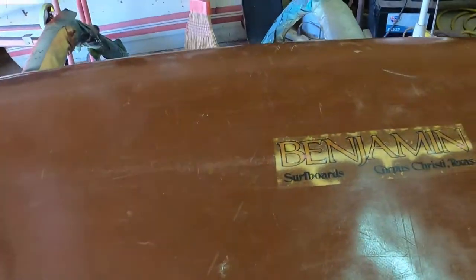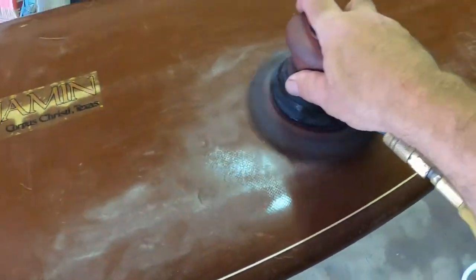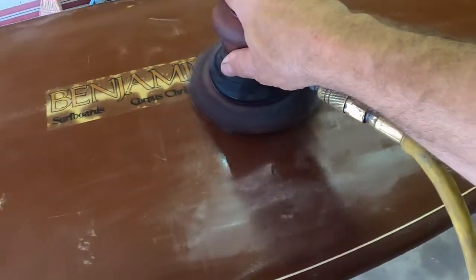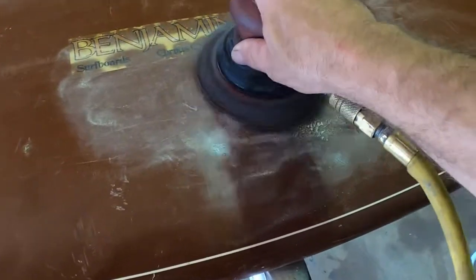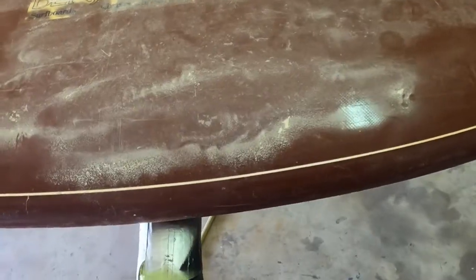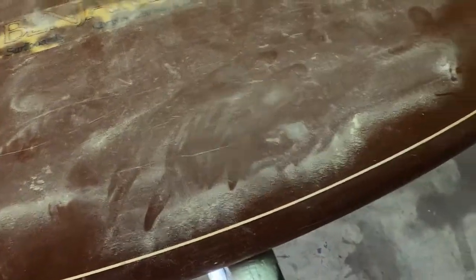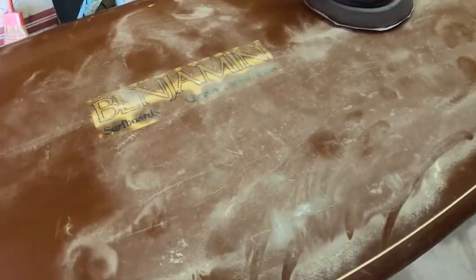This is going to be a wall hanger, so I'm just going to get it sanded. I'll show you what it's going to look like as it gets scuffed up. I'm going to be very vigorous about sanding it, and then I'm going to basically polyester prime the hell out of it — I'll be using House of Color SP 1600. I'll show it when we get to the point of filling up the dings and straightening it out.